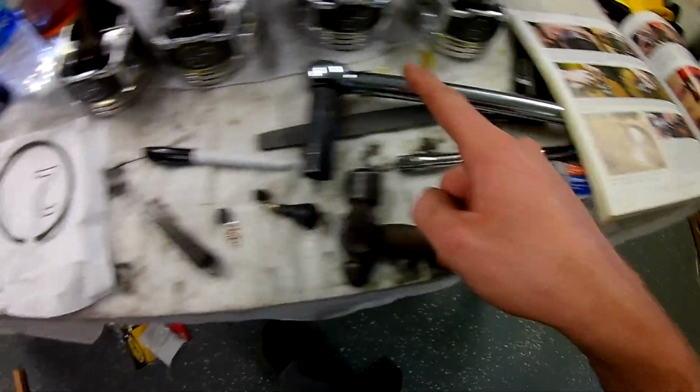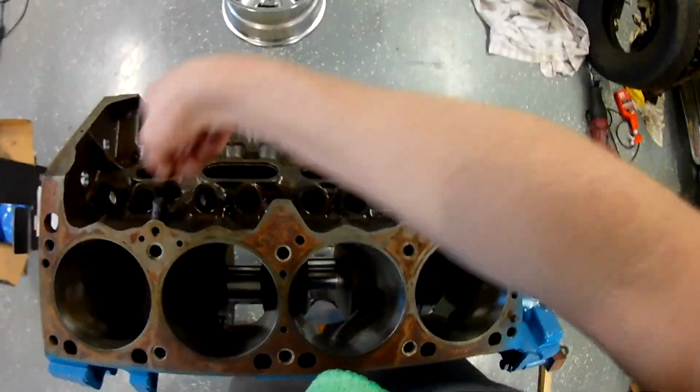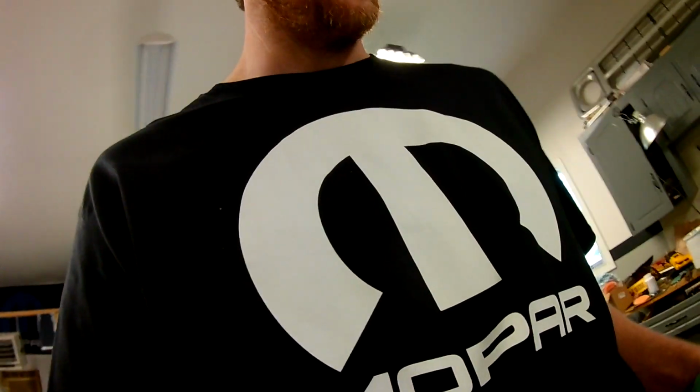Pistons marked for my rings to go on. I'll leave them in a stack. Go ahead and stick my other stacks here. I'm going to check every ring in the block before I see you next time. And on episode 3, we're going to knock some pistons in. So thank y'all for watching and sticking with me on this build. I will make it to a drag strip with this at some point, I promise. And we'll see what a 360 with 60 over Speed Pro pistons can do. I'll also, after I get the pistons in next time, measure the piston height, see how far down they are in the bore, and be able to calculate my compression for you.